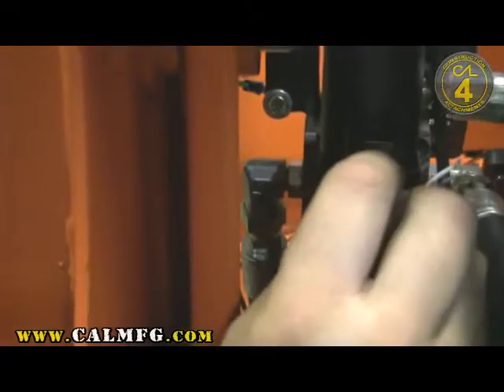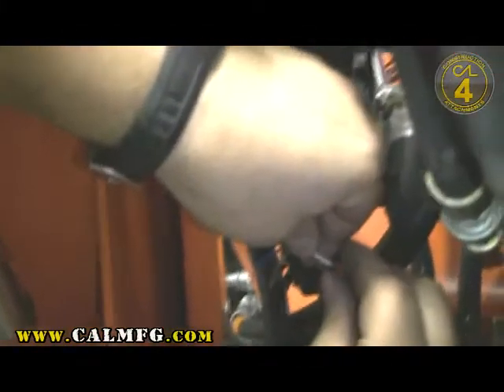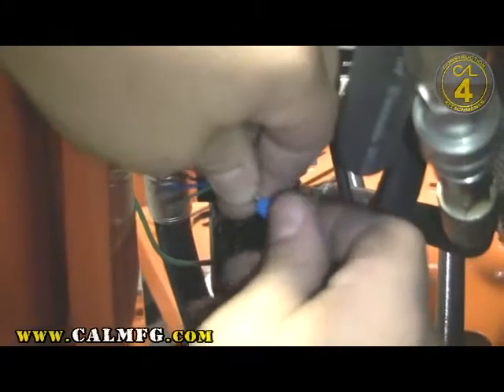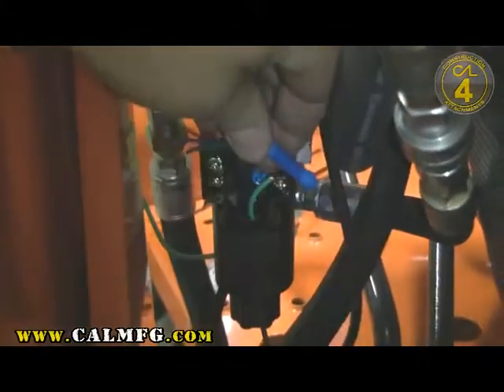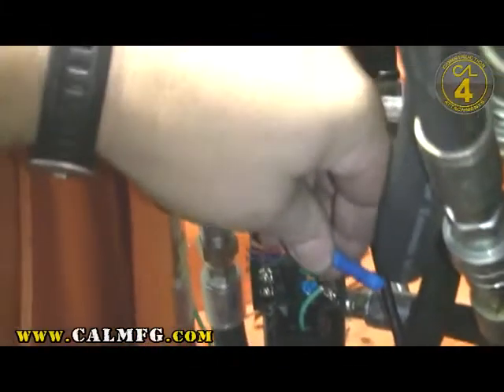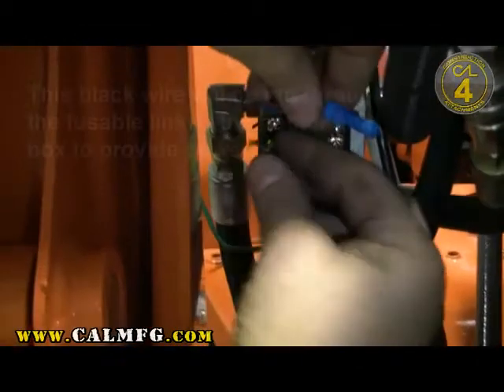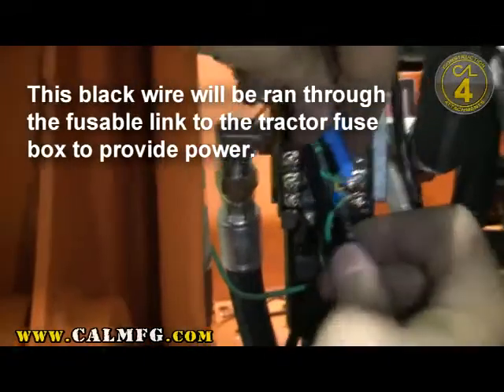Now this is outlined in your instructions. You have an orange, a black, and a red wire that will not be used on this handle. You've got some butt connectors included in your kit. We're going to make a connection right here between the extra wire that we put in and the brown and white wire. Go ahead and insert the brown and white, get a little bit of crimp on there so they don't come off, and insert that extra wire in the other end of our butt connector.